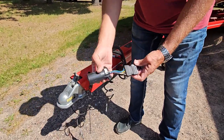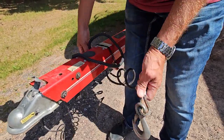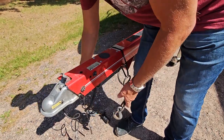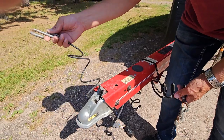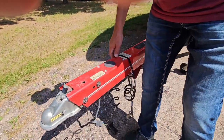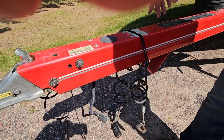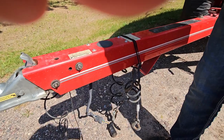This has both connections for either a flat connection or the round connection. You have both your hooks here that go up to your vehicle, and then you also have your safety hook here — so those three connections. Also along the trailer you'll see a few grease fittings. This trailer has surge brakes, so when you stop, the momentum will actually engage the brakes on the trailer.